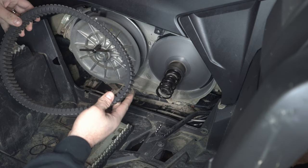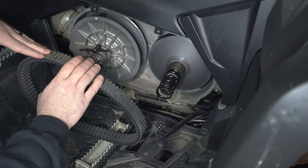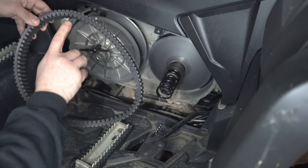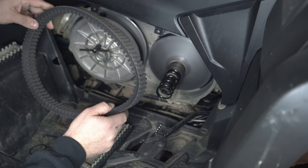If you want to look over your belt, your owner's manual will give you the specifications for belt wear, and each CF Moto is different. Mine here is 32 millimeters — if it's below that it's time to replace. You'll want to measure this with a set of calipers. If you physically inspect it and it looks shiny, or you can see any kind of abnormal wear or tear, definitely replace it — don't even worry about measuring it.